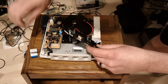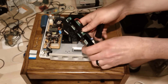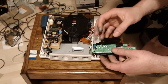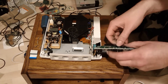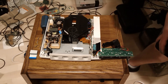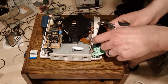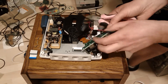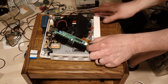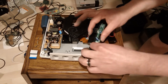Let's take these screws out and set them down here. One note: never ever touch anything here. There's a very slight chance you'll get shocked, but I have messed with enough electronics that I have been shocked enough times and it is not fun. With my AAA adapter that I put in here — you don't want that — this can short that out. It also runs the power here to the fan. Just quickly disconnect that. Don't ever pull on the cords themselves because they can come dislodged from the connector.